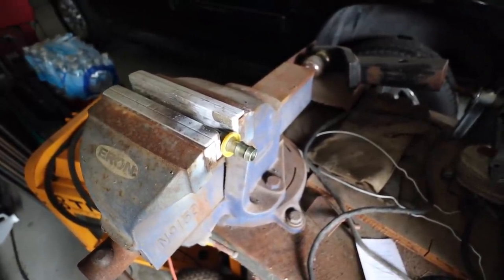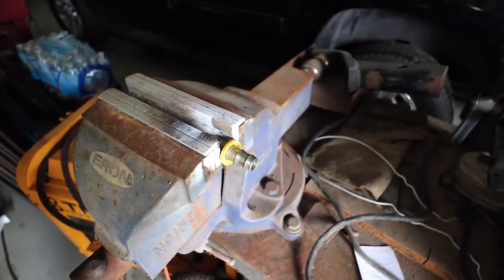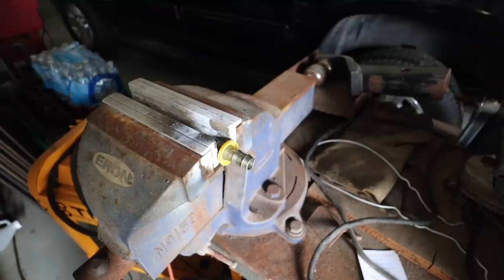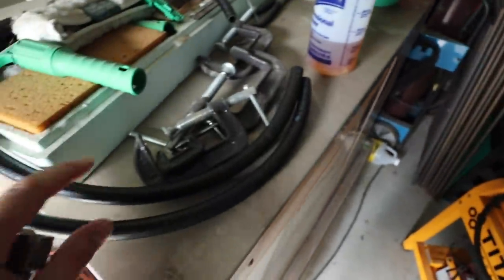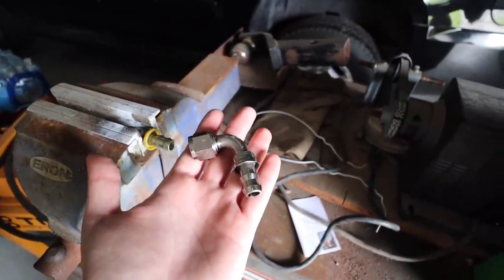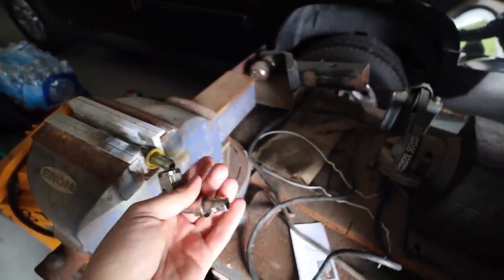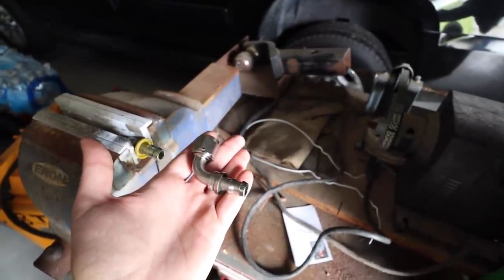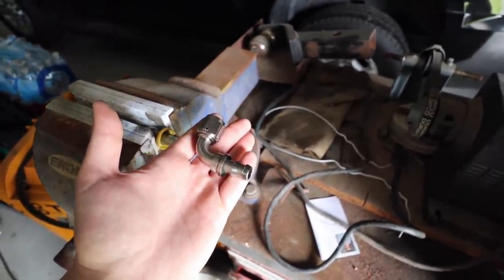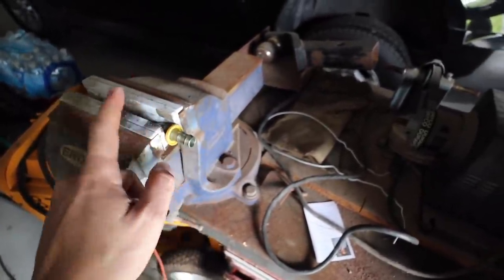One of the things I have to do is fabricate some new oil lines. We've got two new lines going in. We're actually replacing an old one that we could have probably used, but it had a little bit of cracking at the end — good opportunity to put a new one on. I've got my fitting in the vise; I'm about to take my hose. This is a push lock hose. That fitting is basically a 90-degree AN8 fitting. I'm going to do two hoses — 90 degrees on one side, then either straights or 45s on the other. I'll get one side in place, put it in the airplane, route it, cut it to length, fire sleeve it, and then put the new other sides on.